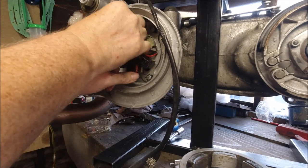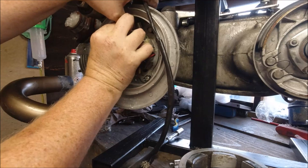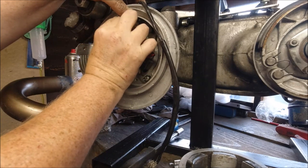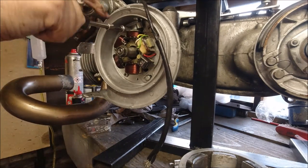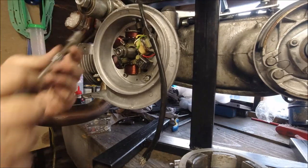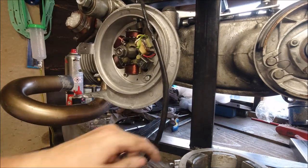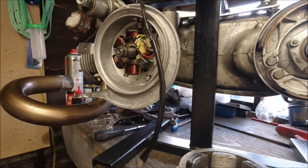Judging by the markings, that is where the stator plate was, so I'm just going to tighten that down for the moment. That just goes on there and pinches our cable out of the way so it doesn't get destroyed by the rotor or flywheel. Make sure that's around the right way — which it's not — and tighten that up hand-tight first, then stick it on the ratchet.